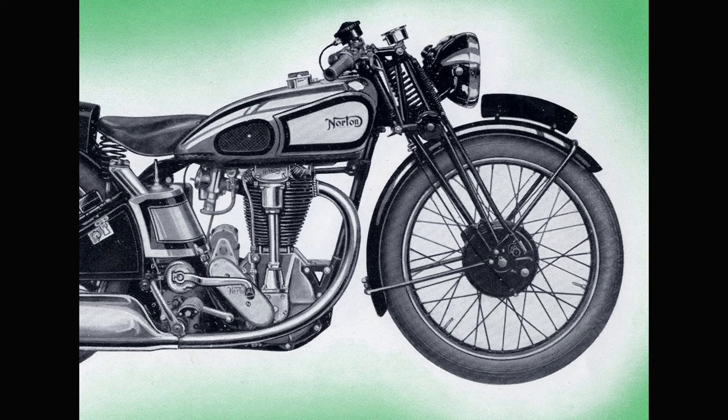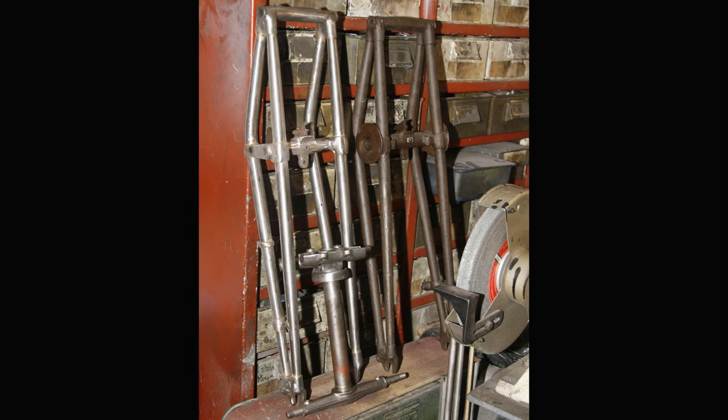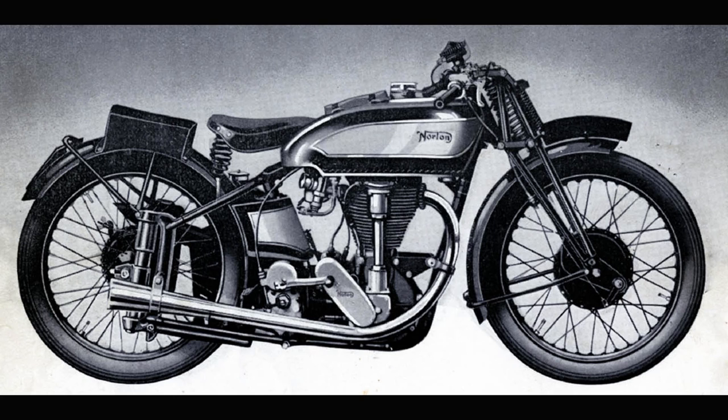These look like inter blades, but actually if you look at the photographs of them unpainted, when you turn it sideways, while the overhead valve and side valve type have a side damper - as did the inters - the type shown here don't have any provision for a side damper. And that's the sign that they're the later competition type, so effectively pre-war Manx.